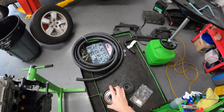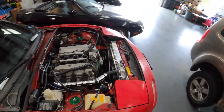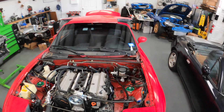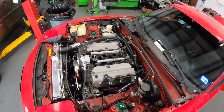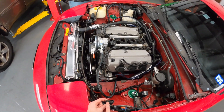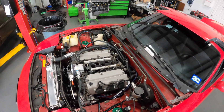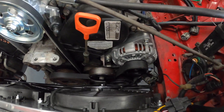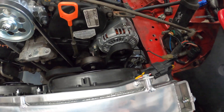The customer came over this past week and brought me an AC clutch kit. This should allow us to run the Miata AC compressor with the belt we were given. I'm a bit optimistic because this pulley sits really far back and the other sits really far forward. We have now installed the AC compressor clutch assembly and the belt lines right up. The power steering line will need to be relocated, but that's not a big deal. I also changed out the connector on the AC compressor so it connects into the Miata connections — a quick little solder job.